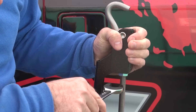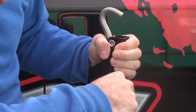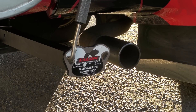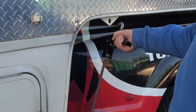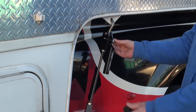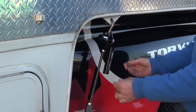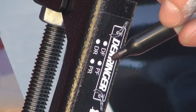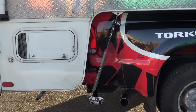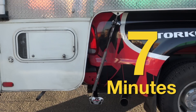Use a wrench to tighten the nut on the threaded rod to secure the Derringer handle. Place the spring-load XL hook bolt into your tie-down bullet plate. Hook the top end of the hook bolt into the camper anchor point. Don't forget to lock it up. The Derringer handle only requires adjustment one time — simply mark the location you fitted the handle to, and you're done. Installation is now complete, and takes about seven minutes to install a set of four.